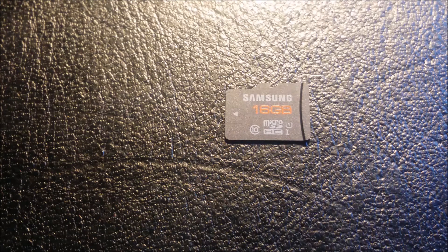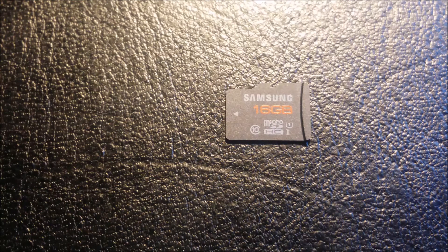Once that is done, you want to right-click on SD-Firmware-Tool and Run as Admin as well. That will open a little program called Rockchip Create Upgrade Disk Tool version 1.4. The first thing you're going to have to do is choose your removable disk — if that is the only removable disk in your computer, it's probably already going to be selected. Then you want to check the Upgrade Firmware box and then choose your firmware.